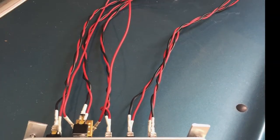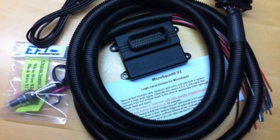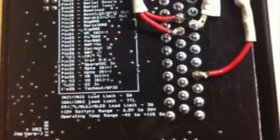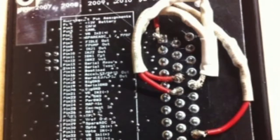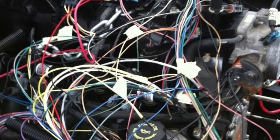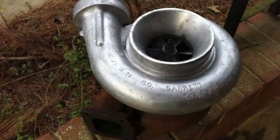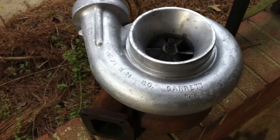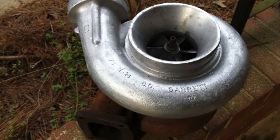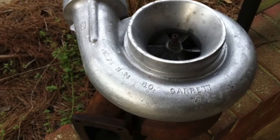The electrical system is all home built — it's run by a Micro Squirt. I bought this before they had the pre-configured one, so it has the old school soldering in the back. The wiring harness is all junkyard and home built. The turbo is a Garrett — not a performance turbo, it's off a Detroit diesel. It's a TV7512, 76mm, T6, .96 AR on the hot side.